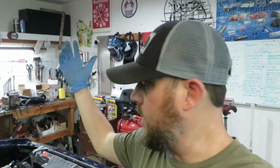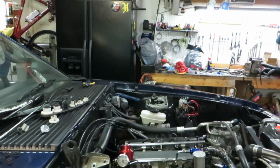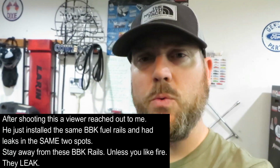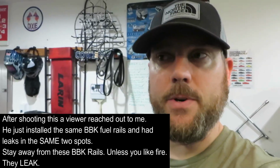I just am. I'm tired of the cheap Chinese crap, and I hate to badmouth BBK. That's the first real BBK product I ever bought. But dude, that thing squirted fuel, no joke, out of the end cap, halfway across the garage floor, and then leaked profusely from the base plate. I thought maybe I forgot the O-rings, so I took everything apart, lubed the O-rings, and made sure everything was really clean. I put everything back on, took my time, made sure everything was nicely seated, screwed it on real nice and tight, turned it on, same exact thing. It made zero difference.